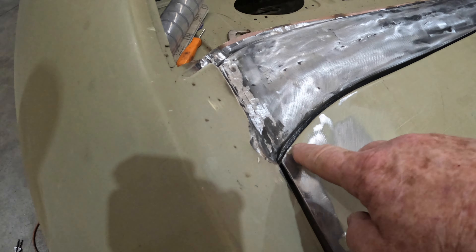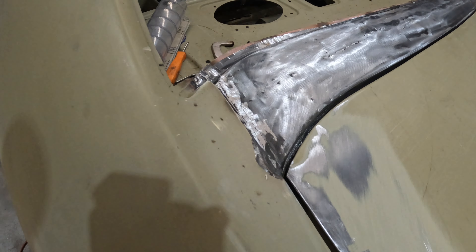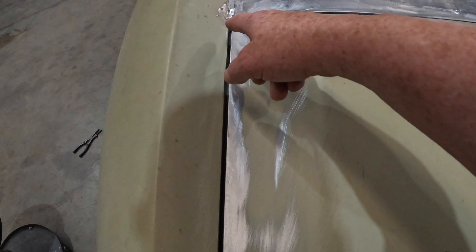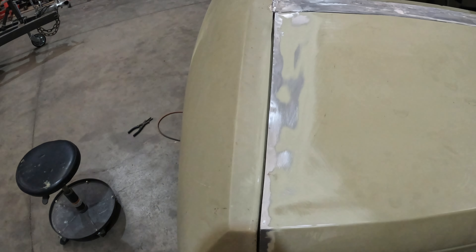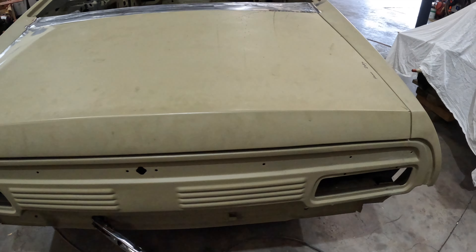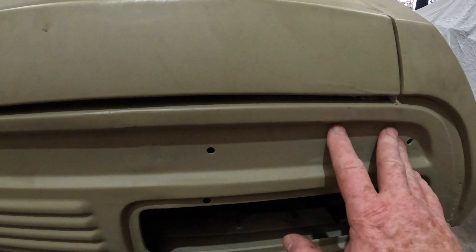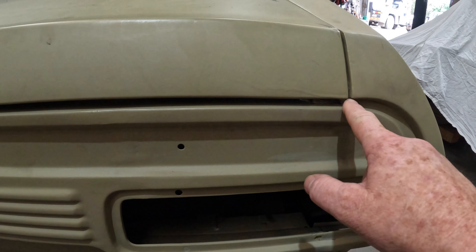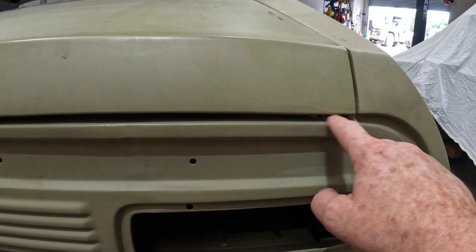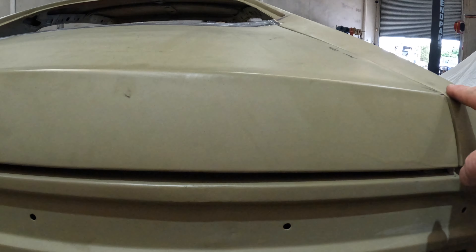When it came to the corner it ended up being a bit tight, so I've actually shaved a little bit off the edge of the boot lid. That hasn't been welded yet — that will have to be welded when I take it off. On this edge I've taken a few millimetres off just to open it up, and the rest of the work will have to be done on the quarter panel itself. This quarter is approximately the right shape, and my aim is to get the bottom edge of the boot lid lined up with that, so you get a continuous line. That's meant the boot lid is maybe a couple of mil higher than that edge.